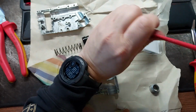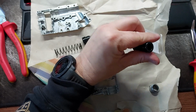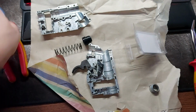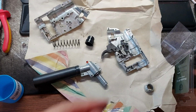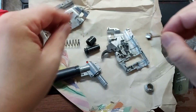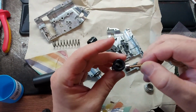After trying it for too long, I chose to use wire lengths, took my drill and simply drilled it out. And well, that worked much better than I thought. I cleaned the piston with a towel and a magnet to get all the fine metal parts of the original pin off the piston, and afterwards I gave it a spray again.